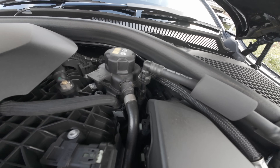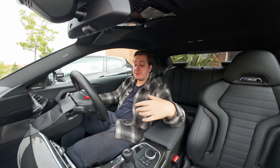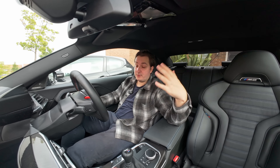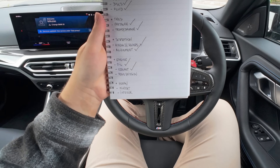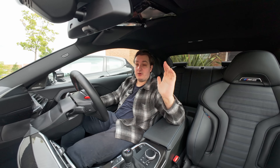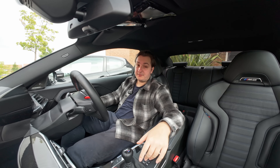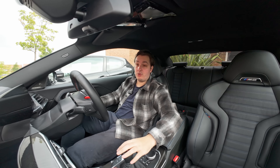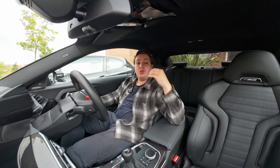Same story for coolant — just check the coolant reservoir, make sure it's at the right level, and change it at the right times: every two years on some cars, every five years on others. If you run out of coolant, your engine will overheat, bearings will be spun, and bad days will be had. If you have an automatic transmission, you also want to, every once in a while, check the status of the automatic transmission fluid. A lot of people think these are sealed for life, but if you're driving the car hard you will need to replace it. Get involved in the owner's forums for your car — especially if you have a ZF 8-speed or a dual-clutch automatic — to figure out exactly when those intervals should be.